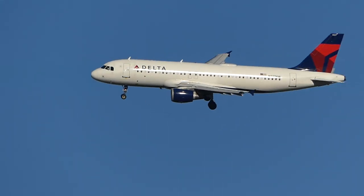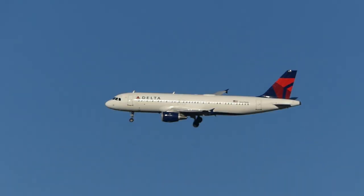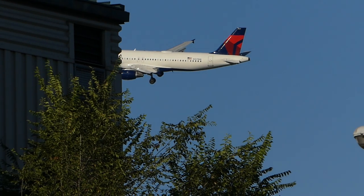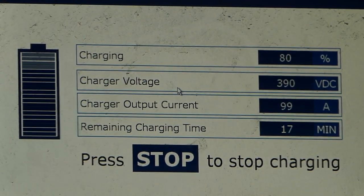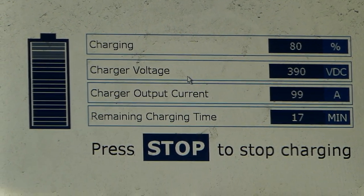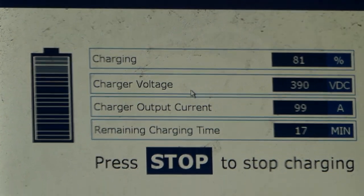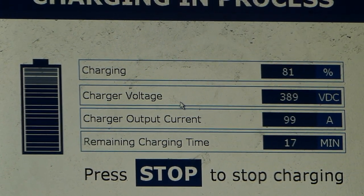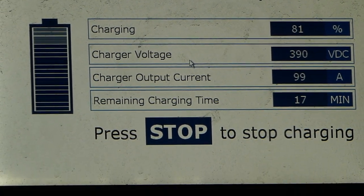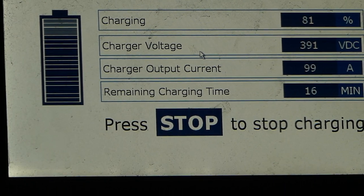I thought there was a TFR around stadiums. To give you an idea of how crazy this is — I'm actually inside the car. I'm charging up in Hillside, New Jersey. It's pumping 390 volts at 99 amps into the car. That's just shy of 39,000 watts that it's pumping into this car. That's insane. Wow — do the math: volts times amps, 390 times 99. Jesus, that's a lot of juice.